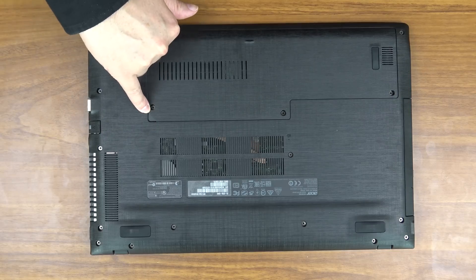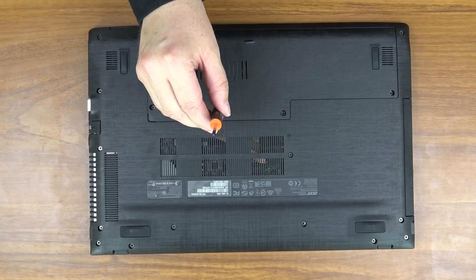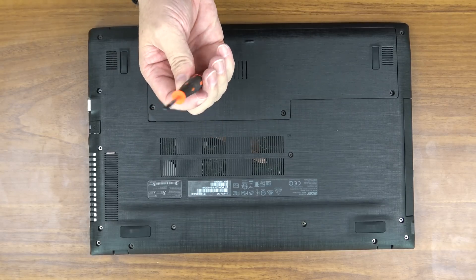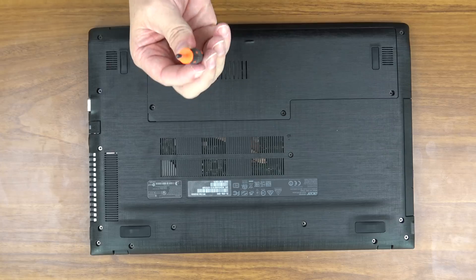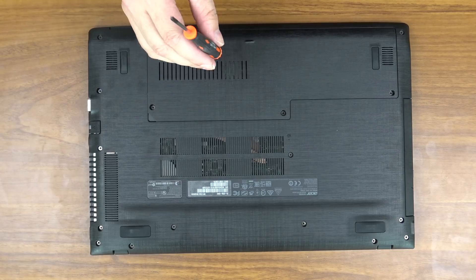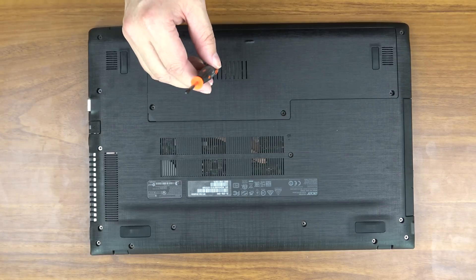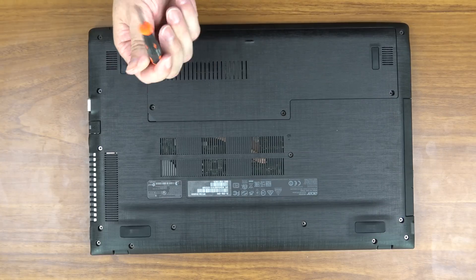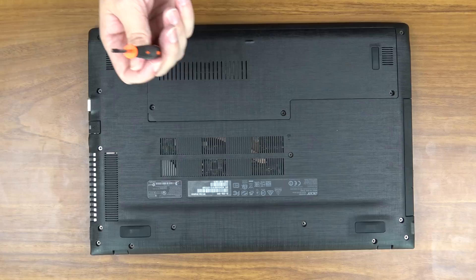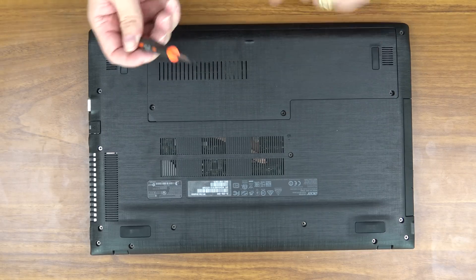They even provide a handy pull tab to pull it off once you've got the three screws out. You will need a number one Phillips screwdriver here. I got this in my Vision Tech kit, which I bought off Amazon for $25. You don't have to spend that much — this just includes about eight different screwdrivers, needle nose pliers, and a handful of other computer-related tools. You can pick up a number one Phillips head screwdriver at major hardware stores for a couple of dollars. If you try to use a standard number two household Phillips head screwdriver, it won't fit.